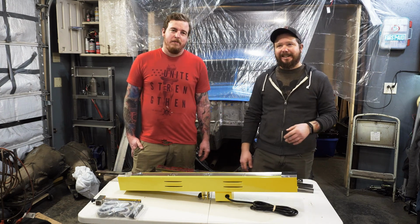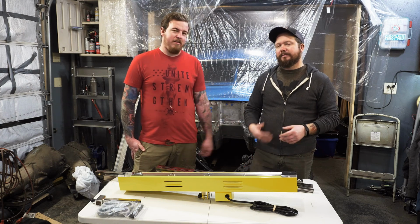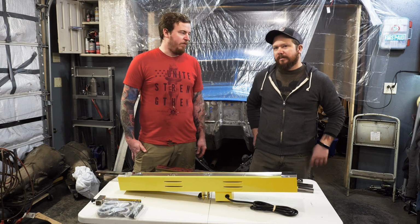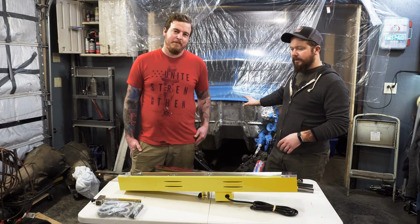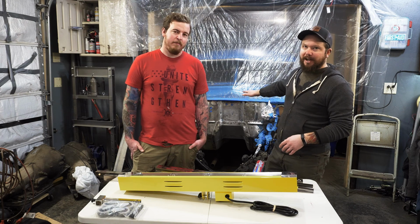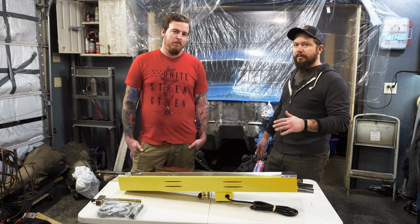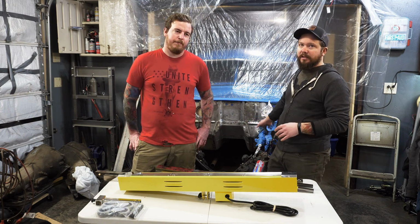Our thermometer over there says 80. The downside is the slab doesn't get that hot, and the car is sitting on the slab. There's not a lot of warm air down at 4 feet. So what ends up happening is we put an infrared temperature gun on the firewall, and we have about 50 degrees up at the top, which is like the lowest temperature that you want to spray something catalyzed with. Towards the bottom, it's in the 40s.